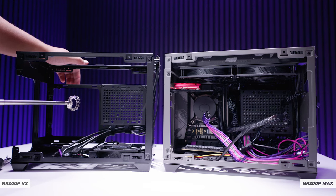First of all, the Ethernet either works or it doesn't work when you reboot the system. It has a mind of its own. And the RGB controller, which communicates to the motherboard through USB on the board itself, is completely fried. It doesn't detect RGB. I installed Windows a bunch of times, did a whole bunch of tweaks, but it looks like the USB controller for the RGB on this board is dead.